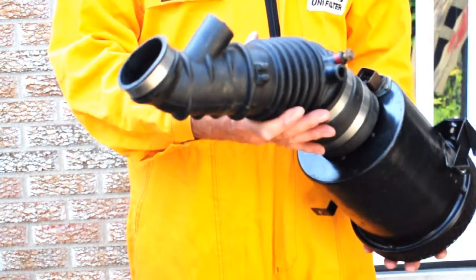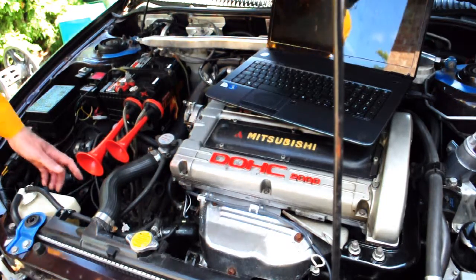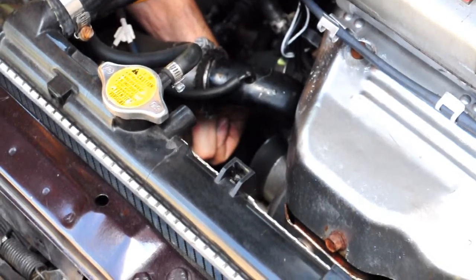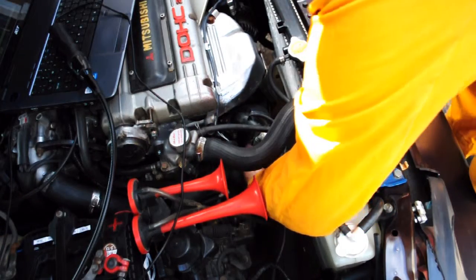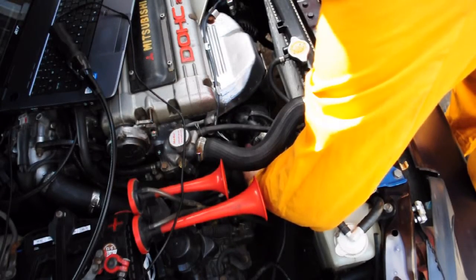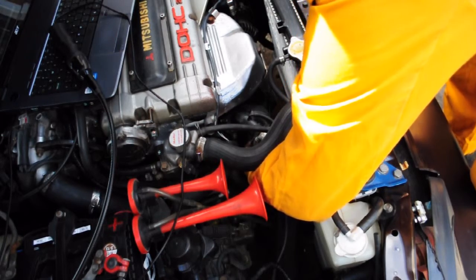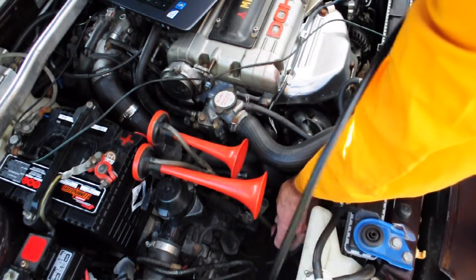This is the air cleaner — we've taken it out because it's really in the way. As you can see, with the 4G63 in this engine bay, there's not much room for anything else; it's very cramped. So we need to get down here and have a look at what's going on. Down here is where we pull the air cleaner off, with the inlet into the turbo. I'm going to reach down and feel the impeller shaft — I can feel quite a bit of slop left and right, but there's no fore-aft movement. That's probably a good thing. Let's get a better look at this using our endoscope.